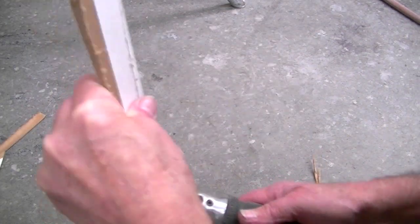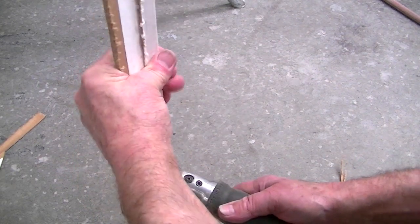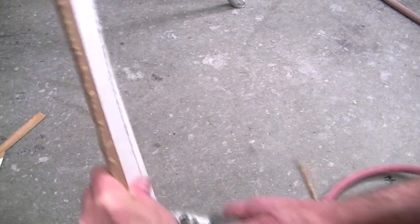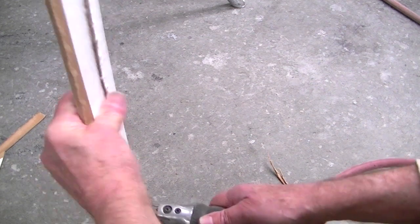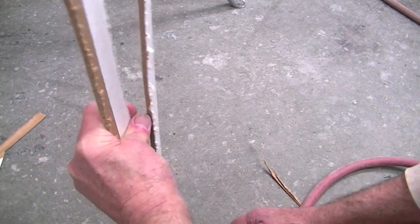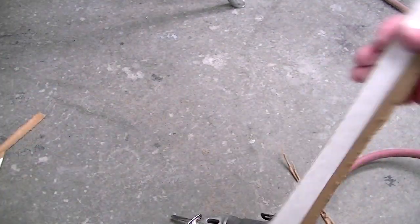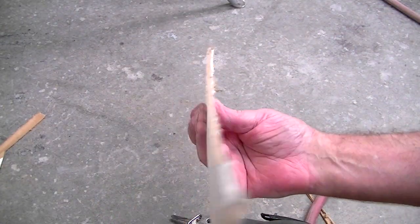Now here's a sample of the board that I used. The gapping board is a non-corrugated cardboard that bends nicely around curves. What I'm going to do is clean it up a little bit, put masking tape on it, yellow masking tape, has a release agent, and this one looks like one that I cut for the door jamb. I use these on all the gaps on the car to give it a consistent gap throughout the car.